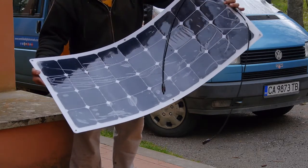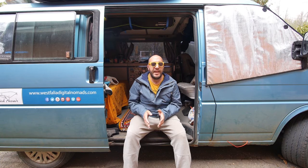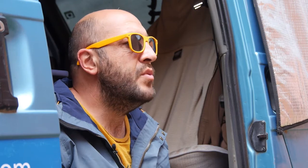I will show you in a later video how to install the new panels. First of all, check out your van because you need to decide where you want to put the solar panel — that's only if you want to fix it permanently. You can also consider a portable solar panel made like a suitcase. We recommend not making any holes in the van, especially if you have a fiberglass roof or even metal, as it's really not a good idea if you want to avoid infiltration. It's also a better choice if you want to sell the van at some point. We fixed ours with super strong silicone glue and it hasn't moved in five years.